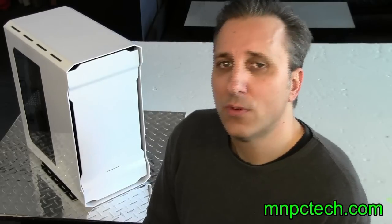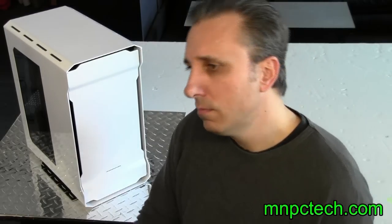Performance: whether you're going to air cool or liquid cool, I do think you're not really taking full advantage of the design if you're just going to air cool. It's really geared for somebody that wants to do either a single loop or two individual loops for liquid cooling. It's 18 inches tall for a micro ATX case — that's huge, that could be a record. In my opinion it's more intended for somebody who wants to liquid cool. But I understand some people don't want to do that yet — maybe you can start with an air cool system and grow into liquid cooling, get an all-in-one, and then the next year think about DIY.